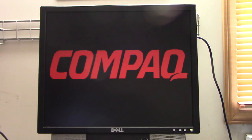Okay, that was actually a very simple problem to fix. I thought I had already set the new CD-ROM drive to slave, but apparently I hadn't, so I switched that jumper around without having to take anything apart, so let's fire it back up. I think we're good to go now. It's detecting the hard drive is 8 gigabytes, whereas it's a 15 gig drive, but I do have drive overlay software already on this drive from another computer it was in, so we should be able to take advantage of that.